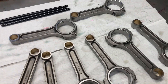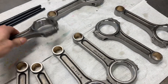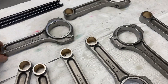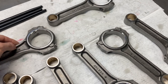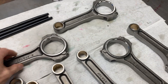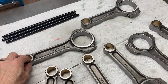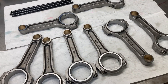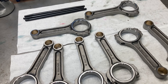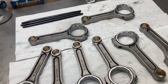This is just a really good bang for your buck set of parts for a street build and the I-Beam rod. Let me back up a little bit and say there's nothing inherently wrong or cheap or whatever with an I-Beam rod. I actually choose to run I-Beam rods when I can because they're generally lighter than H-Beam rods. Most guys see the H-Beam rods are more expensive so they automatically think it must be a higher quality or higher end part, but that's not the case.